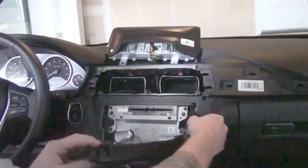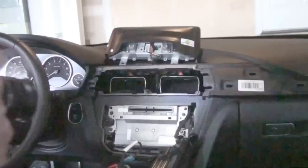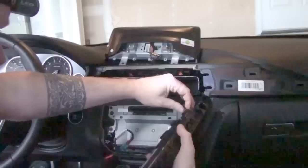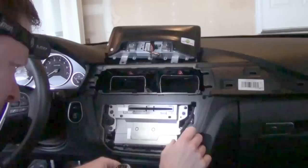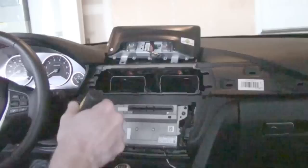This piece just pulls straight off. There's a lot of extra wiring you can get to here, and an easy connector right there — just pull the trim piece up and out of the way, which I'd recommend doing so you don't scratch anything. This plug just walks right back out, so now this trim piece is out of the way. Now here is the stereo — in my case I'm looking at the Harman model. I've got four more Torx screws to pull out so I can get to all of the stereo wiring and CAN bus controls.